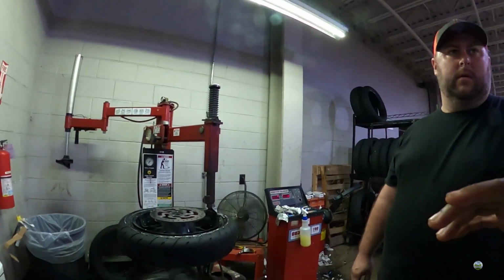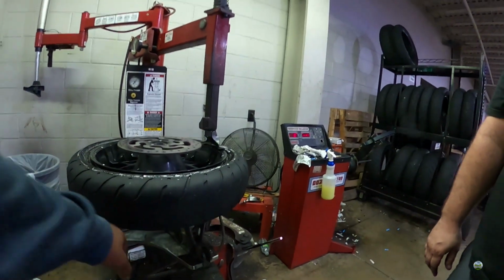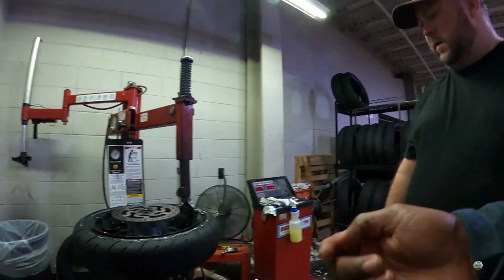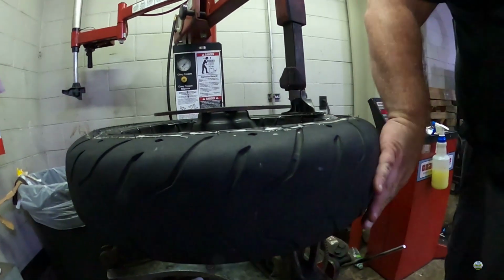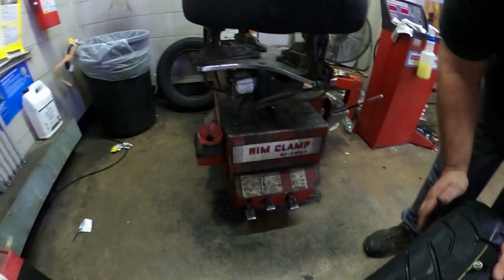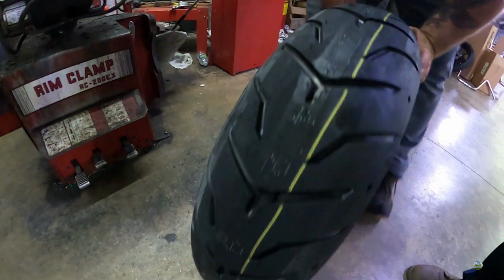He showed Chris the reason that I needed a tire, because a lot of people think, oh, I don't see any wires, so it's a good tire. But there are certain telltale signs. One of the biggest ones is there's no tread here in the center. We want to look here. We have a brand new tire, a lot of meat comparatively. Wow. Yeah, wear rings on it.